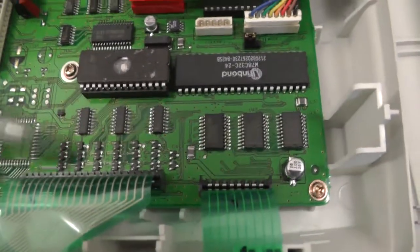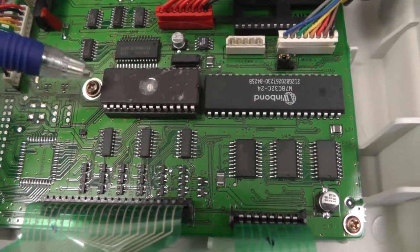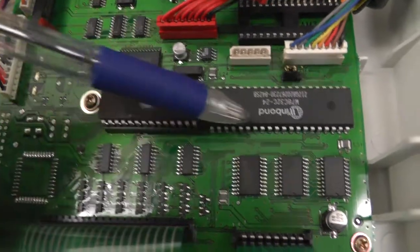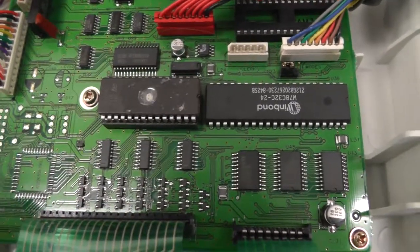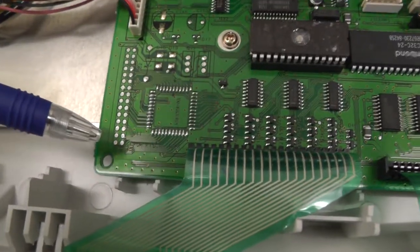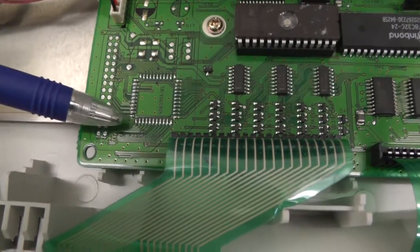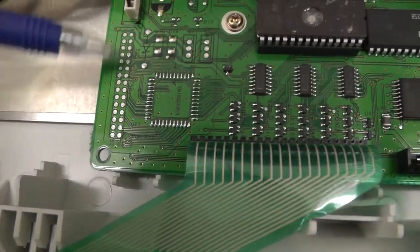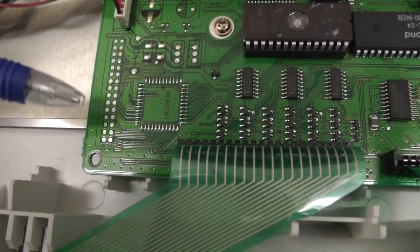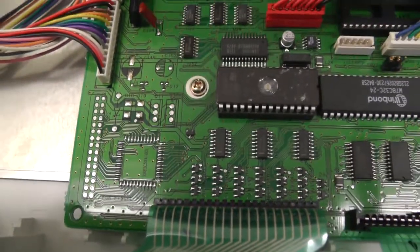That's why you need the drivers, the multiplexers, and yeah, a dedicated EEPROM. This is also RAM for this microcontroller, probably. And here on the side, we have even more connections, which are not populated. That seems to be another surface mount microcontroller with a lot of pins, but I'm not sure what it's used for. Maybe in an additional option.